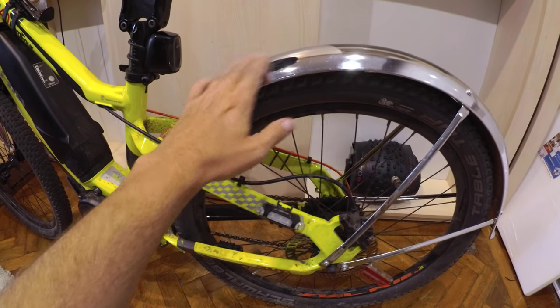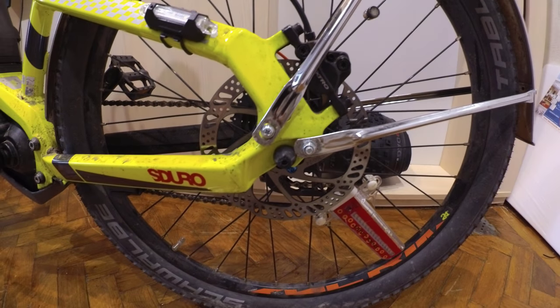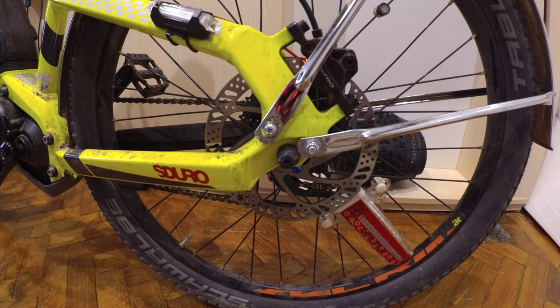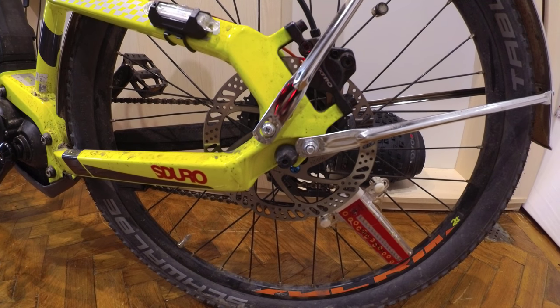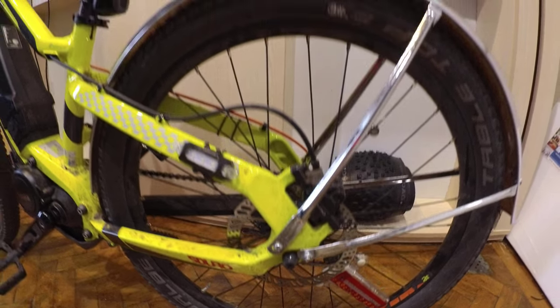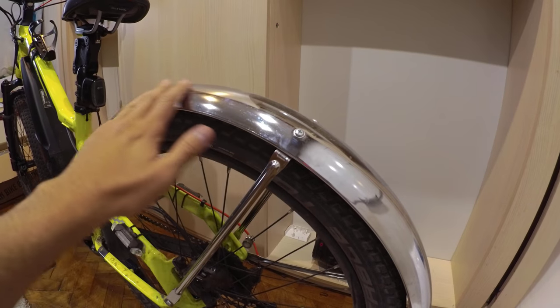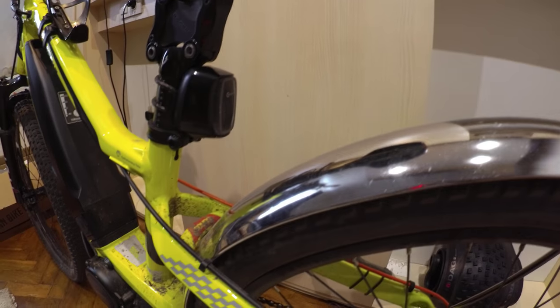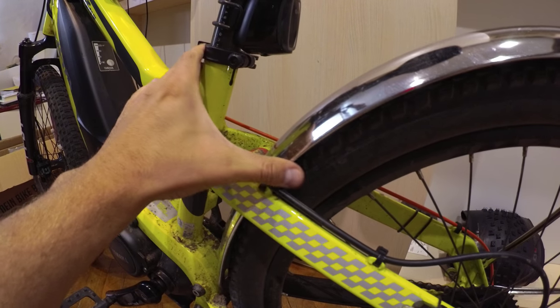The last thing I wanted to mention is the rear fender. As you remember from the last video, I didn't have the fender attached, and now I've attached it very crudely. This is a fender set I bought from Classic Cycle, a German company which sells parts for cruiser bicycles. A cruiser bicycle might have 24-inch 3.0 wheels, so the fender is quite big. These parts are really quite expensive even though they're probably made in China, because there isn't much demand for cruiser parts. Given that it's a stainless steel fender, it's very difficult to paint — the best thing would be to cover it with 3M carbon film using a heat gun. To attach it, I'm reusing the kickstand mounting hole and another spurious hole on the other side, so it's not ideal and it does make a lot of noise.